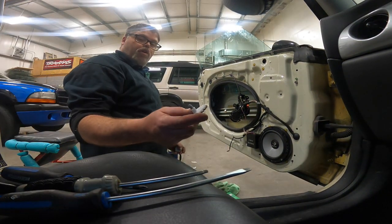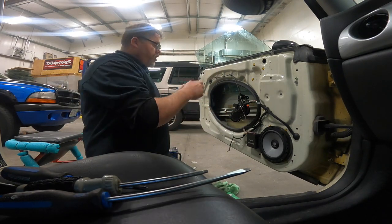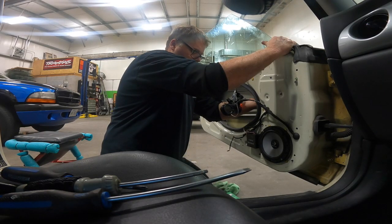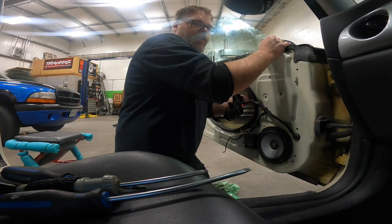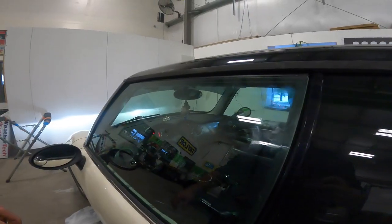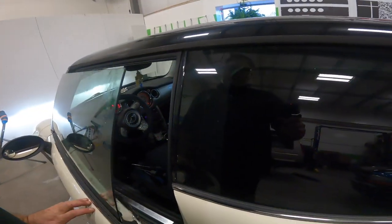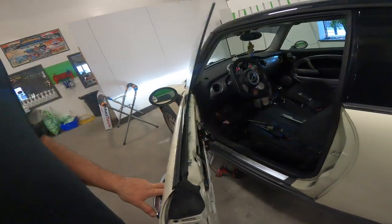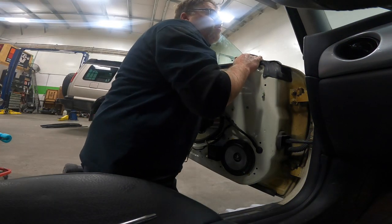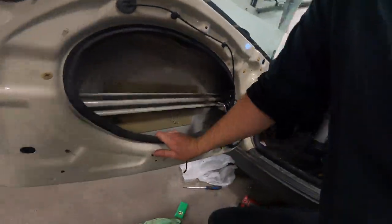So how these work is you got these things that screw in through the door glass and it gives you enough room where you can actually adjust the door glass. There's one — come up a little further, there it is. Just snug them up, don't tighten them yet because we have to adjust the door glass. So now we can check the fitment. By the looks of it, it's going to go forward, maybe down a little bit on this end, up a little bit on that end, maybe back a hair. Now we'll tighten it up. Bring it back down, tighten one up then the other. Don't go too tight. Now we'll roll this up and see if it sits right.